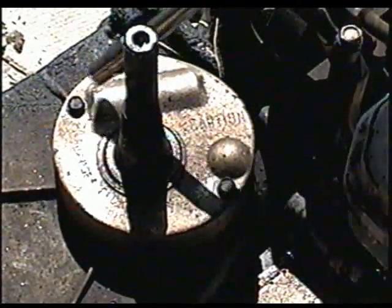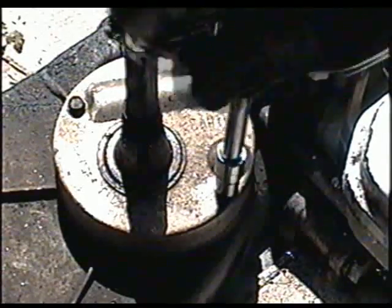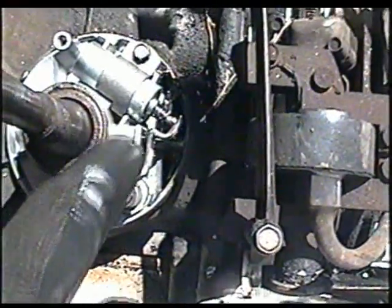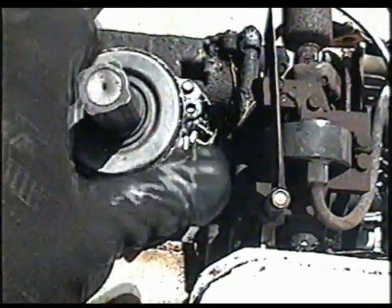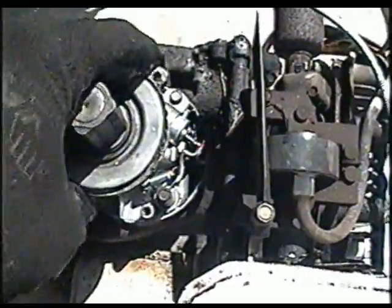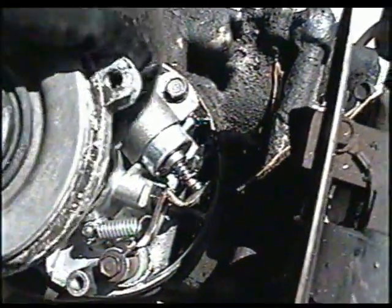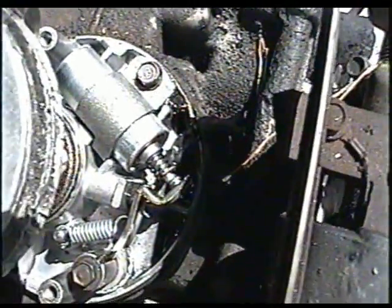After the flywheel is off you have to remove these two bolts here — they're a quarter inch. Now once you remove this cover, the points and the condenser are under there. So there are the points right there and the condenser. I'm going to put this back on for now so that I can spin the motor over and see what the gap on the points is. When I turn the motor over, the points do not even open — and that's why it's not sparking.